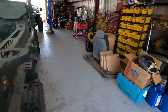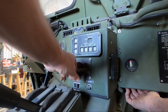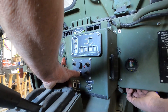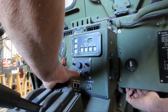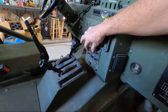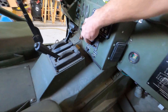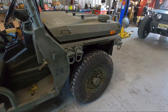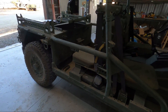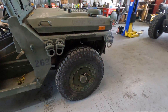Once we've done that, we've got the ride height set right where we want it. Come back around - we're going to push the button down here, hold it, push this one, and count to ten. That should set the ride height for the normal ride position. To test it, let's go to kneeling and lower it all the way down. Now go to ride height and push it home for two seconds - there it is, a little adjustment and we're right there.